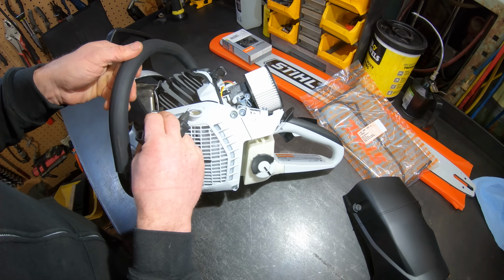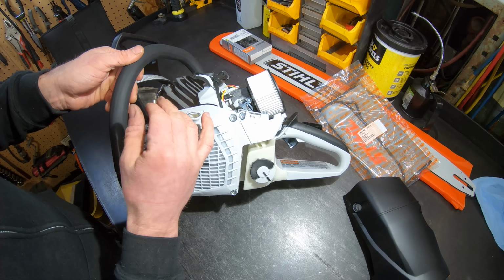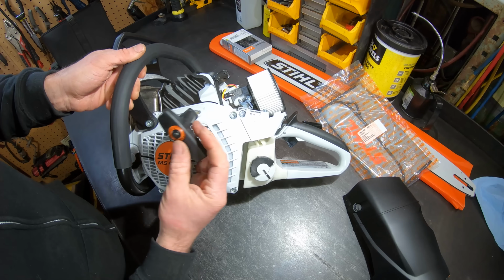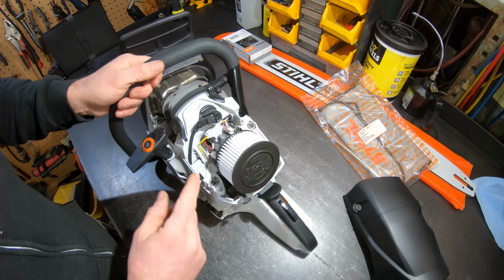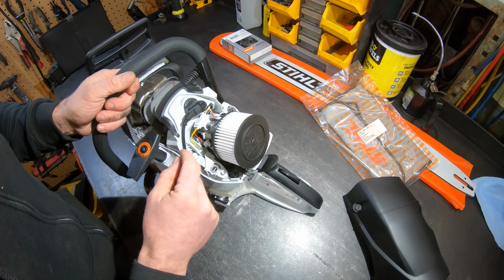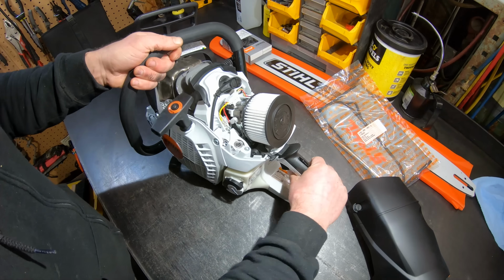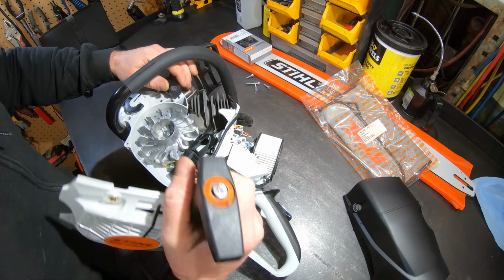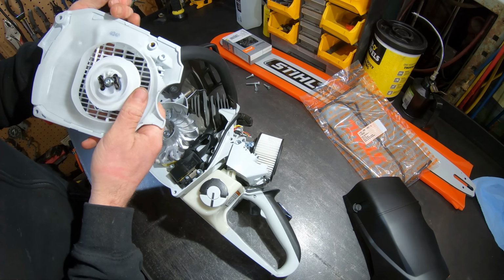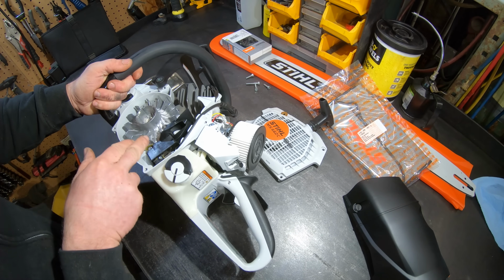So in keeping with their new saws, the orientation on the pistons is slightly back and the cooling fins are at an angle, so they get better cooling and less build up in there with that style. It is M-tronic, so you get wires, yay, that you can't fix because you can't hook it up to a computer. Awesome, fun times. Double dogs. Just like most newer saws, you have the centrifugal filtration.